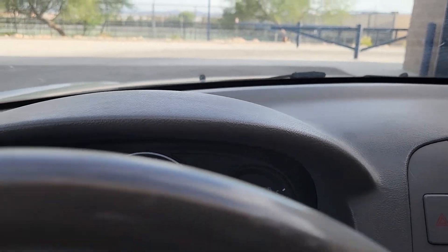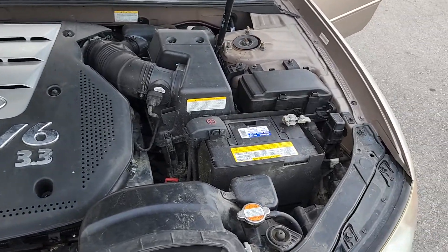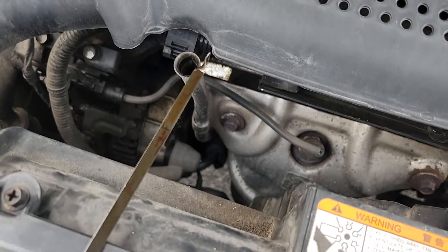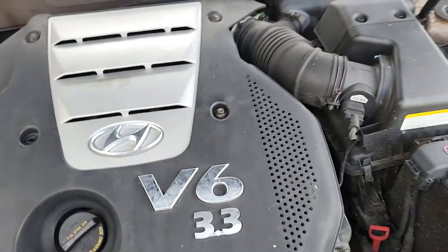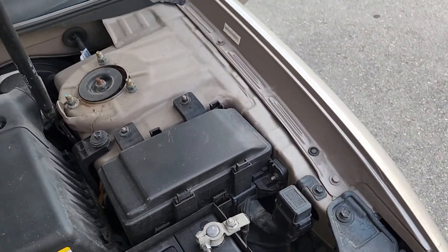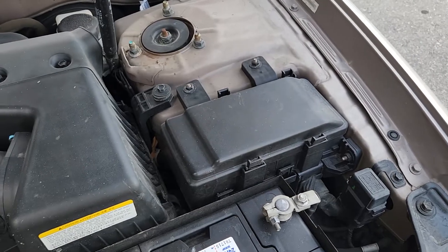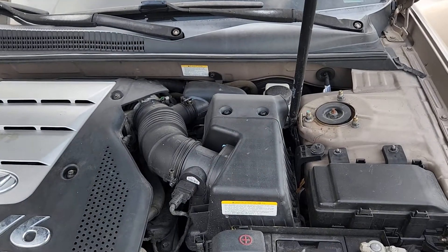Let's take a look under the hood. You can see this engine's real clean, the battery's nice and clean, and there's no corrosion on the terminals. The first thing you want to do when you look at any used car is examine the oil dipstick — you want to see no bubbles or milkiness to the oil, because bubbles mean water's getting in and that means head gasket problems, which is a very common problem in a hot desert climate. You also want to look at the transmission fluid and make sure it's not black and sludgy. The fluids on this car are tip top, and everything runs cool.